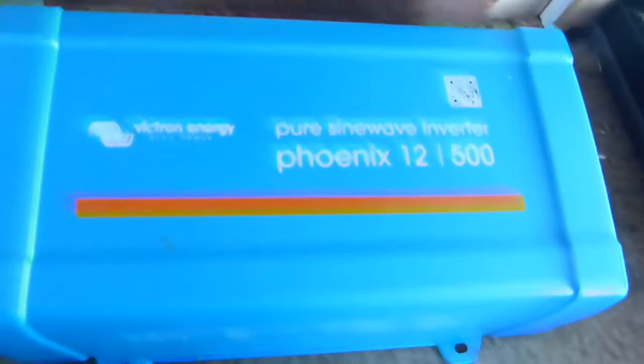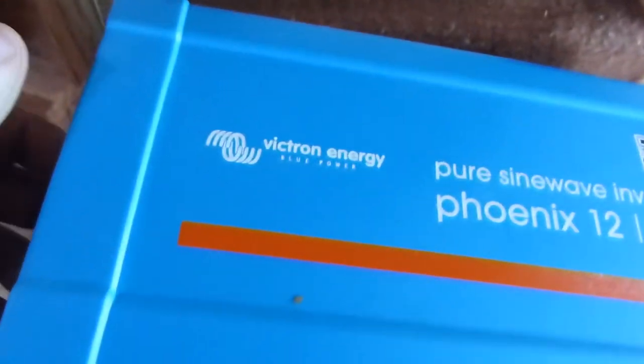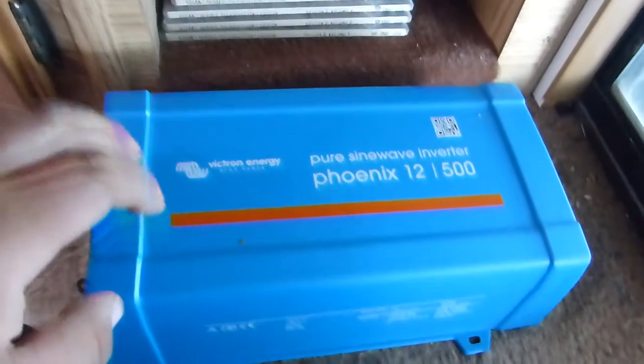We just have this inverter over here that we're gonna put behind — we have to clear this out, put it in the shelf, bolt it down, and run two wires from this to the battery. I'm thinking we can make it easier because there's a switch right here, but I don't want to reach down there all the time to switch it on and off — you can put it in a less power-drawing mode. So we can run an exterior switch that'll hopefully go right here to kick it on and off. This has a fan built in, so I was a little worried about overheating in a tight space, but it does have a fan so I don't think we need to worry about that. It doesn't cause too much heat. We'll get that all bolted in and this will be completely done.